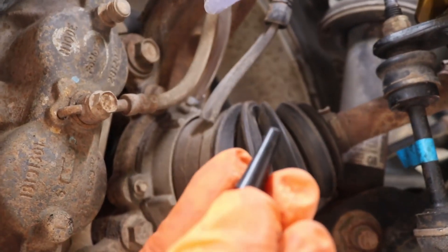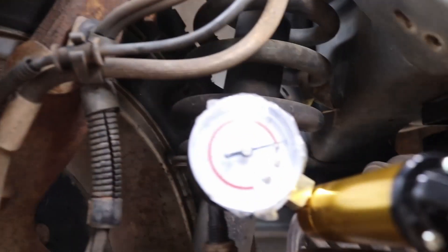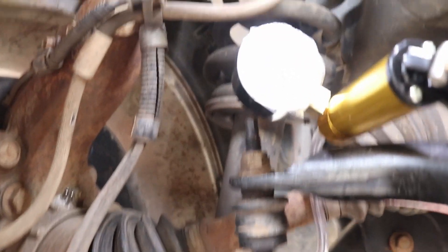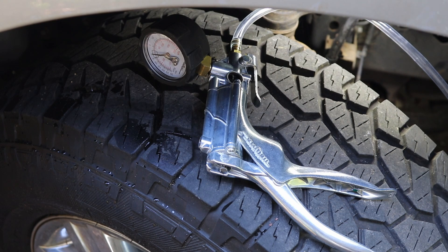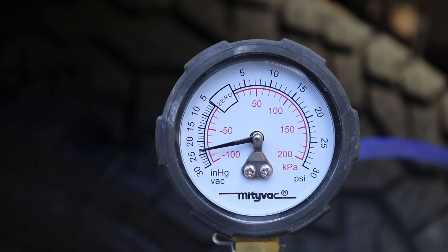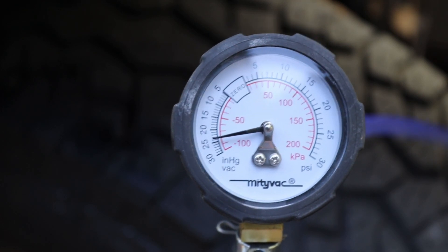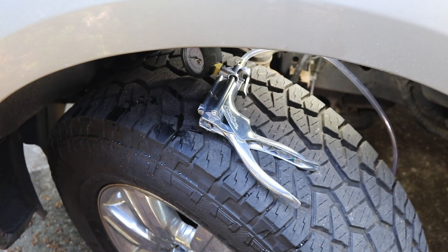Just like above, we'll take one of these little fittings and stick it in the bigger side. With it hooked up we'll start it and check our vacuum gauge to make sure we're getting the right vacuum down to this port. Coming up under here with it running, we have about 12 inches of mercury — that was low and there was a leak, so we had to replace it. After the fix, taking a look at our vacuum gauge now it's about 24 inches of mercury, which is where it should be. If you're getting a low reading like 12 inches of mercury, you have a hole somewhere in your lines — they are notorious for this on these model trucks. So the vacuum lines were also part of the problem.